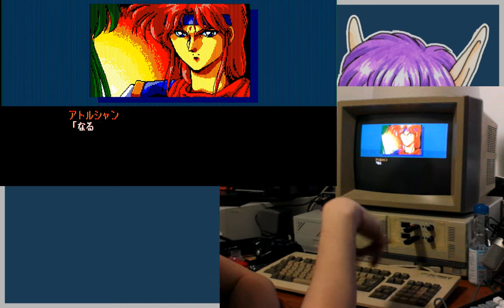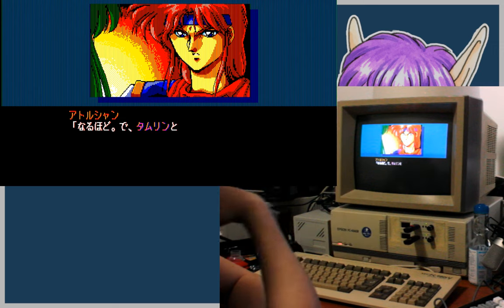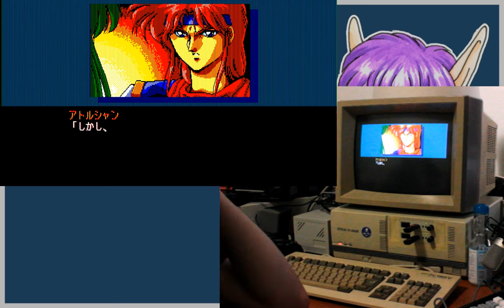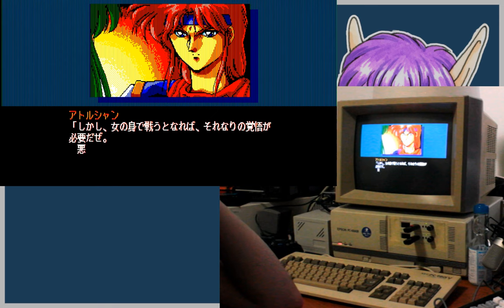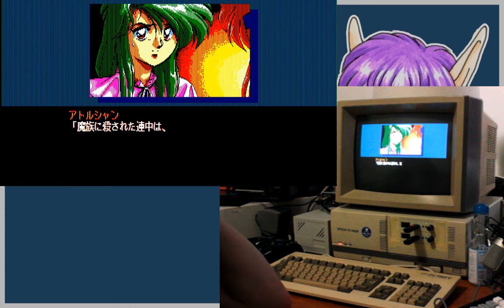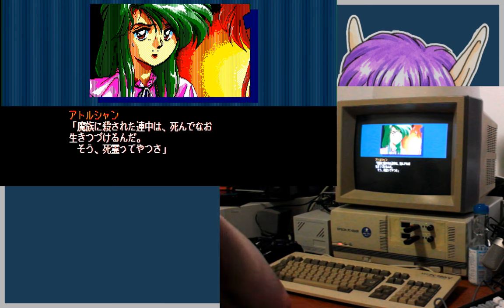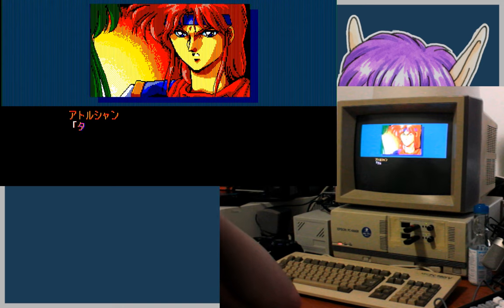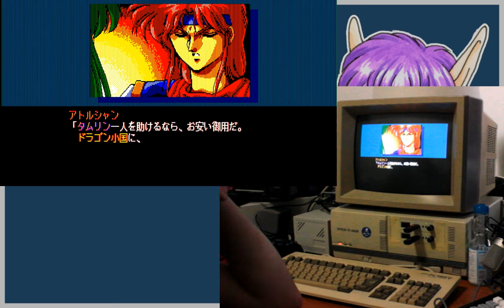Basically, how often it needs to draw a line per second is based on the vertical line count as much as anything else. So it's a combination of that and the vertical refresh rate that determine the horizontal scan rate. And most PCs would use like 31 kHz-ish, or maybe 15 to 16 kHz-ish, not 24. And there's kind of a dead zone where monitors can't handle it for the most part. Even my Amiga monitor doesn't handle it, but I think maybe the Commodore 1950 would handle it.